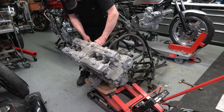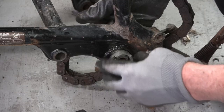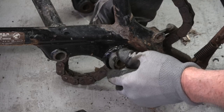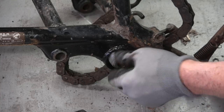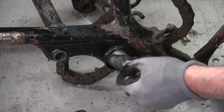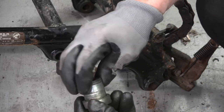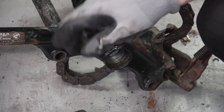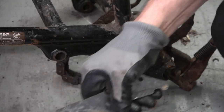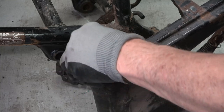I had forgotten to disconnect the oil lines off the oil cooler before taking the frame off. At this point I'm slowing the video down because I want to explain: the rear swing arm on an '80 is much different than a '79 — it's got a threaded collar setup, and the bearings have ball bearings on one side and needle bearings on the other.